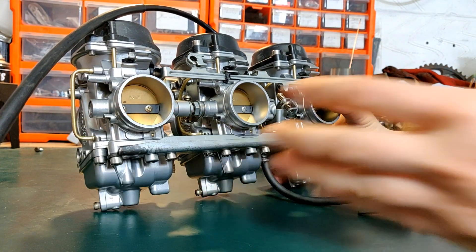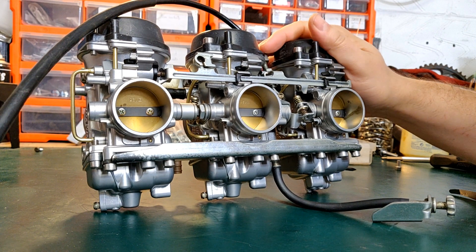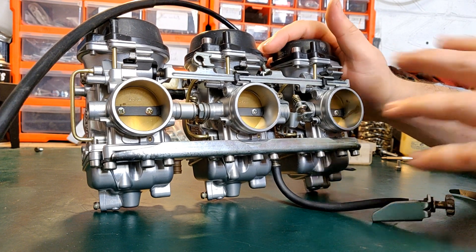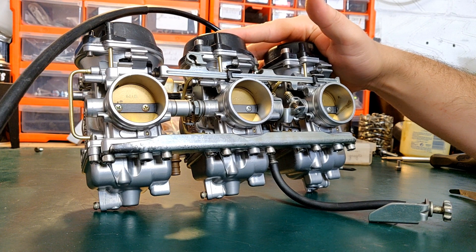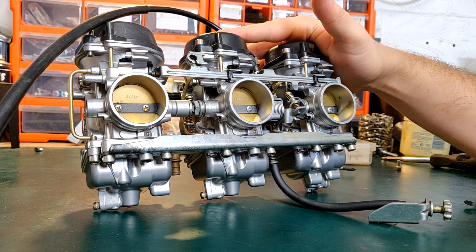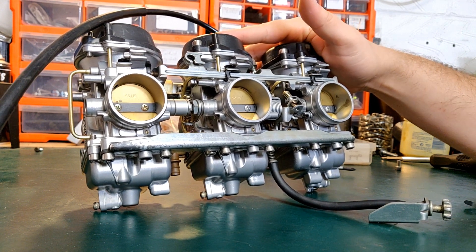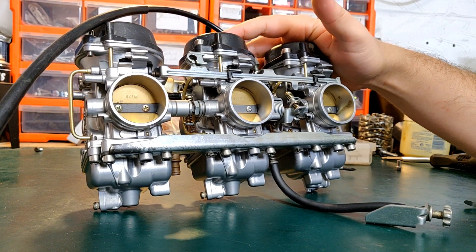So that is effectively how you can quickly set your carbs up to get the bike running. I'm not going to argue with people who say that vacuum gauges are much better - yes, you can fine-tune each individual carb with vacuum gauges much better, because there might be differences in how each individual carb works. But just to get your bike on the road and the engine running, I guarantee that will be sufficient. I've had an XJR 1300 running on carbs synced just with feeler gauges. I synced a Bandit 1200 which worked just fine as well, and I had the GPX 750 which also ran without attaching vacuum gauges post that initial adjustment. It didn't take us five minutes and you can get everything running nicely.